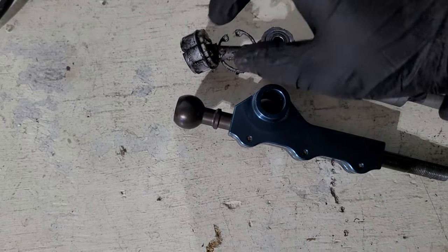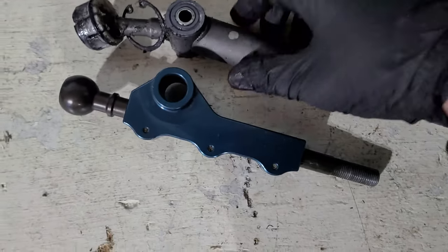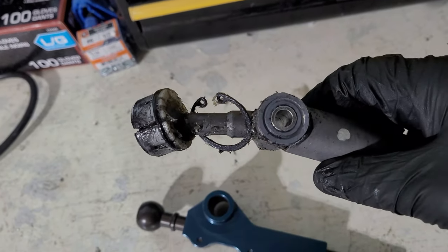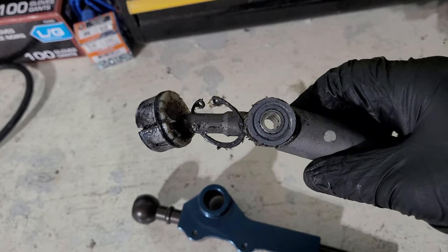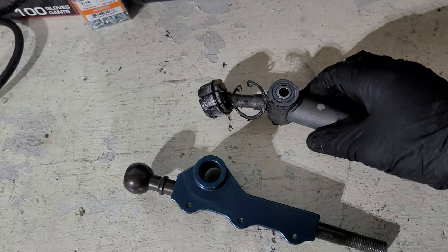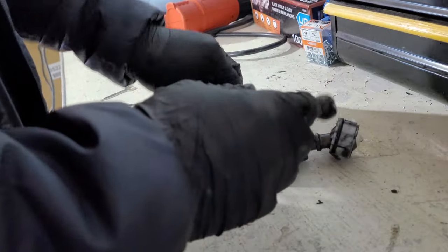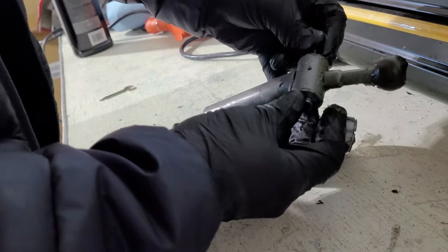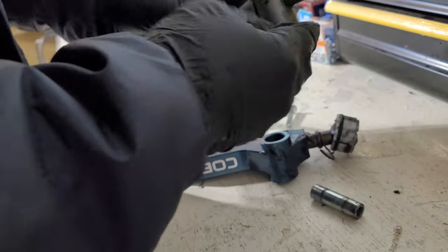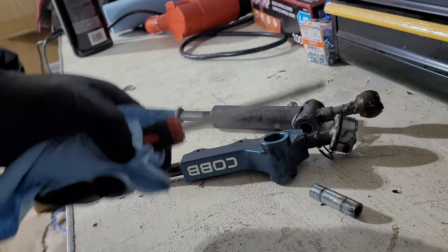We're going to have to take off this ball, which is just a pull. Pop it on. Put the snap ring on over here so it's ready to put into the car. And then the last thing will be this bushing here — that bushing is just going to slide right out of there. We'll just take a screwdriver or something and knock that out and then slide it into the new one. I'm going to take as much grease as I can and put it on there as well. I love a flathead screwdriver — it's useful for everything.